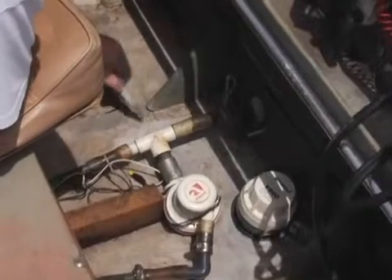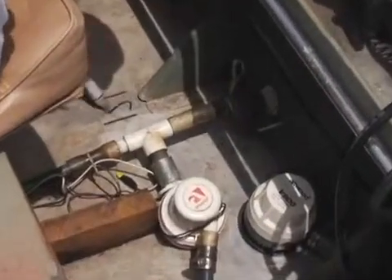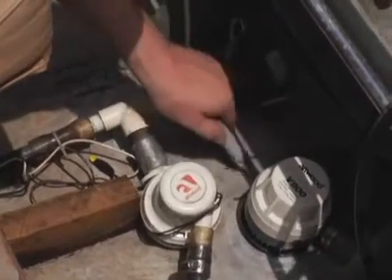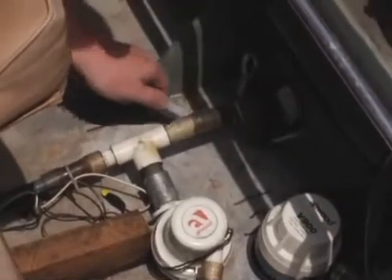With aluminum hulls, this area may not be as obvious. Boats like this one with rivets along their bottom side create more turbulence in the water, so finding an area of smooth water flow can be a challenge, but it is possible in most cases. Select an area within one foot of the center keel of the boat and directly in front of the bottom corner of the transom — this area is often near the drain plug. Your goal is to select an area that is between ridges or rivets, preferably on the driver's side of the boat.